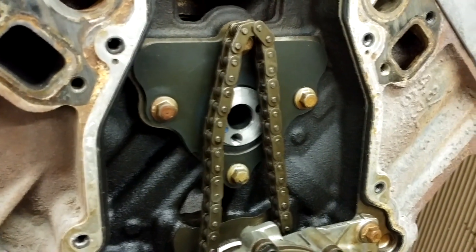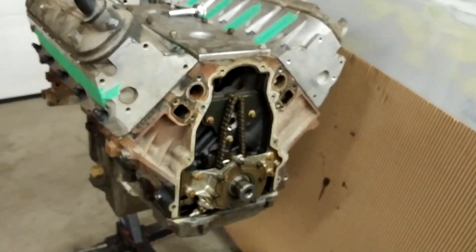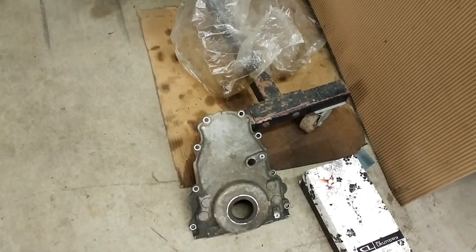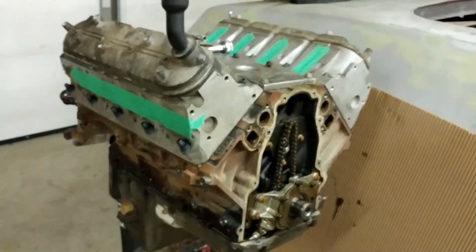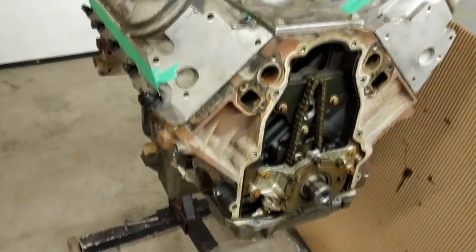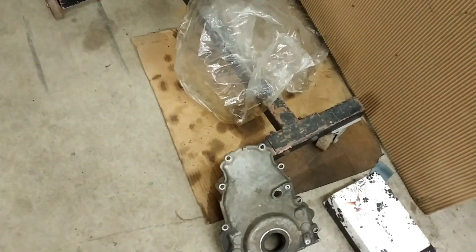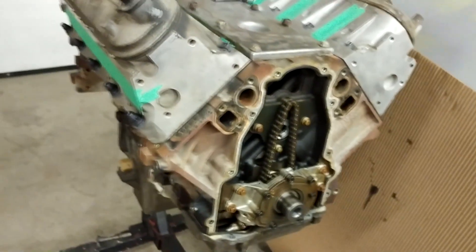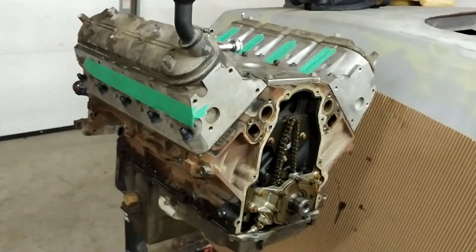A lot of people hate on the LS9 cam and say it's not even worth it because it's only $130, which is cheap, but you have to get the timing cover, which is different, the sensor, and also a different cam gear, which I ordered but isn't here yet. I went with it because I can get the timing cover from Rob - 60 bucks. The gear was 40, and if I can cut up the sensor and make it work, that's free. So all in all, compared to a $350 custom grind for a little cam or something, for this budget motor this should work out just fine.